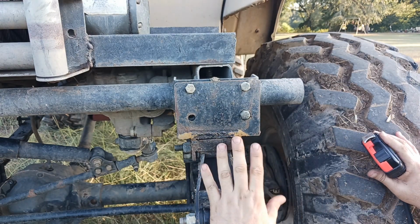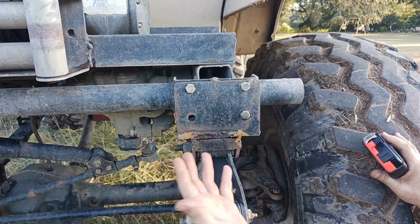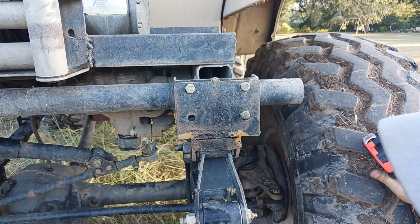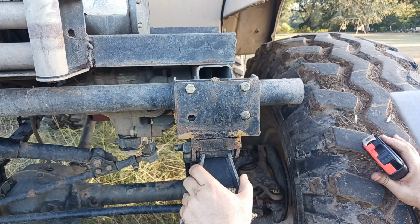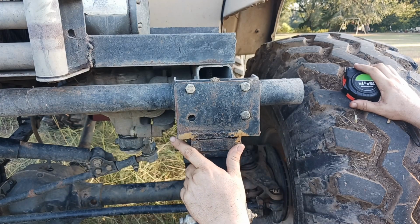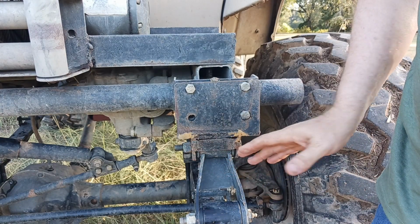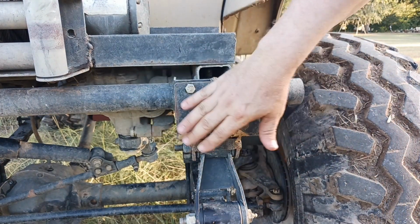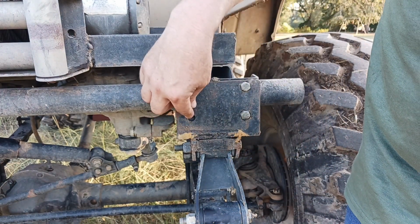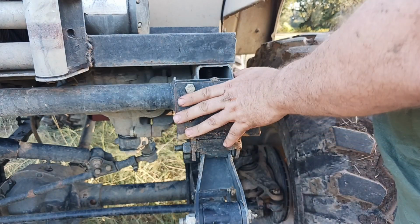All right, I didn't know they were different lengths here and here until I got it welded together. And it ended up with two identical ones. So I've got both of my long sides pointing towards the driver's side, sure as throwing the springs off to one side. I don't know, haven't measured it. Really don't care. I'm not going to be driving it up and down the highway, so it doesn't really bother me. It was just the fact that the directions do not say anything about the offset, which way it goes and don't go. And I just didn't have enough bolts there, reason why there's not a bolt in there. I gotta loosen these up, jack it up, put a bolt in, and then tighten everything back up.